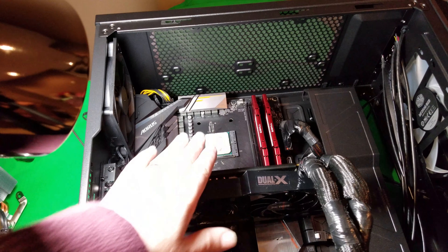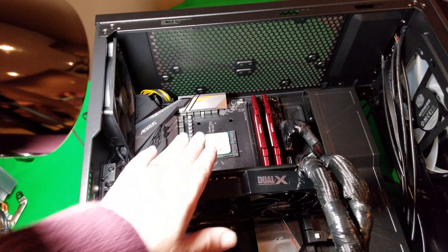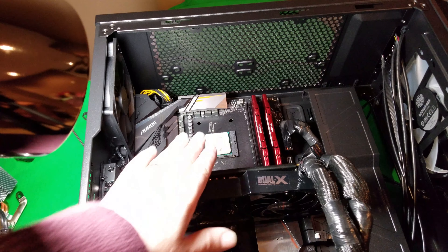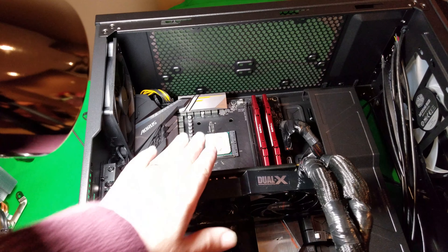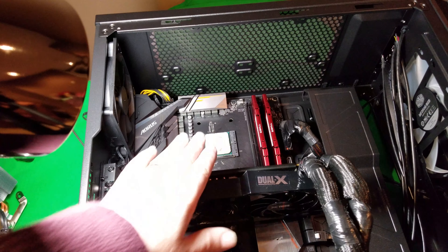You can see your thermal paste — good coverage, and it had pretty good coverage on here. The next step is going to be to remove the thermal paste before we go ahead and put our backplate on. As soon as I loosened these screws, the little backplate has dropped down. That's okay because I've got it setting on a table and it's just setting flush on the other side. But since we're not going to use that anyway, it's not a big deal. We're just going to go ahead and put our bracket on and put our new cooler on. First we're going to remove the thermal paste, then we're going to reapply the thermal paste, put our bracket up through, and I'll show you all those steps here in just a second.